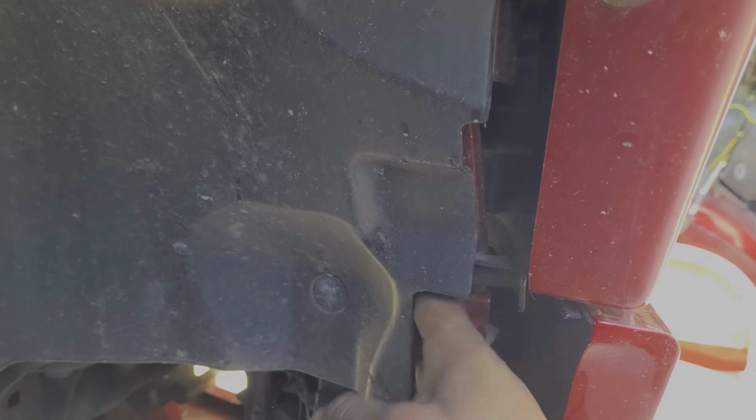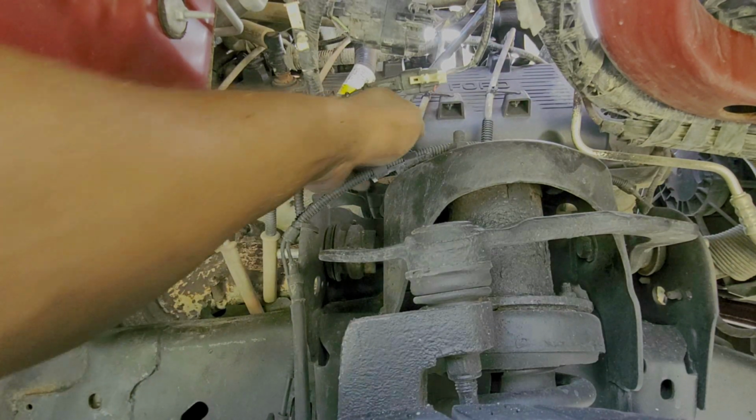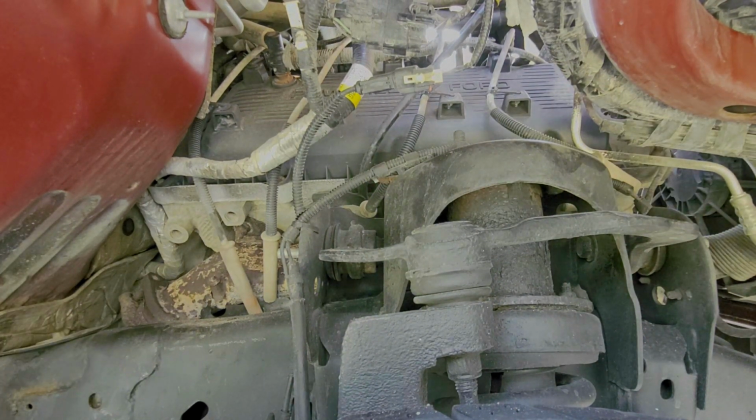And then one pressure clip down here. Nice little sturdy tug there. Alright, now that's out of the way, we'll go ahead and pull our spark plug wires here, because we're going to change those out as well. There we go. And just like before, 5/8. Let's go ahead and get these plugs off.